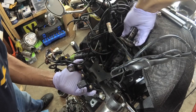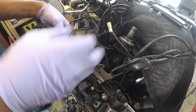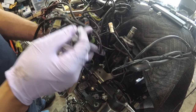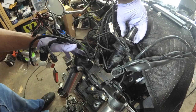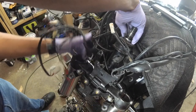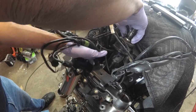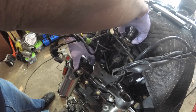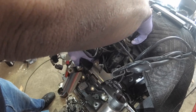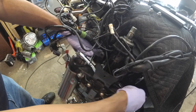As you may know, last time I did the head bearings — when I changed the race out — I used a special tool for that. I usually torque this by the manual, so that's what I'm going to do. But I like to just check it to make sure it's not binding or anything like that. It should turn freely — I mean, aside from a million wires on here, that's part of having a fairing. It's going to be a little tighter once assembled, but it's in there and you don't have any play.